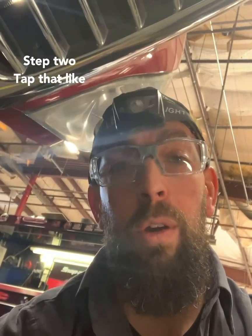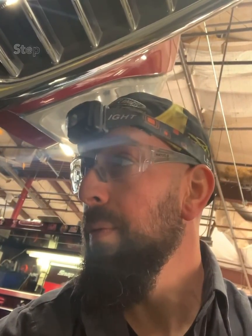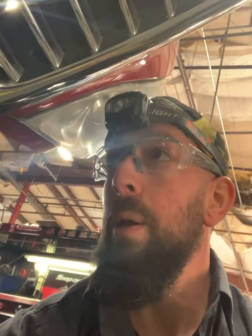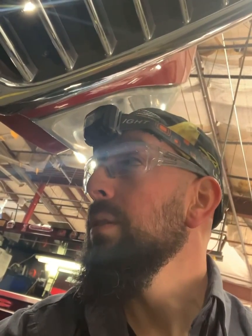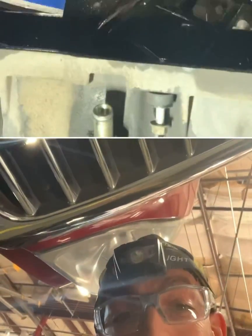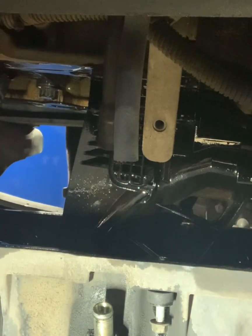What's happening again. As you can tell we're getting a little nasty now. If you guys saw my other video about dropping an oil pan and resealing it, then you'd understand what we're doing now. We're going to reseal the O-rings in the oil suction pickup tubes. Big problem with these older Cascadias — they tend to get dry and cracked and start sucking air, and you get some oil pressure issues.